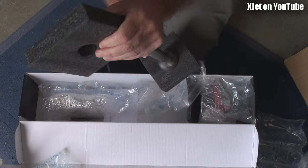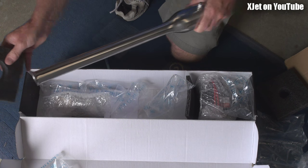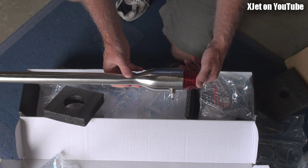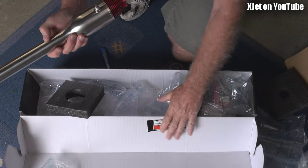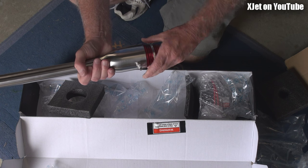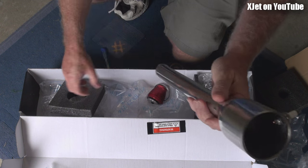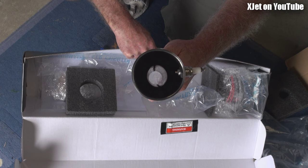Hopefully it's better — oh man, look at that! Look at the ovalness in that tailpipe. That is awful. This is worse than the first one. All the material has been ground out of it as well. Let me look inside because that's the crucial factor — how much have they ground out? Look at that oval — I'll try and get a shot so you can see right through there with a white background. Look how oval that is. That is awful.